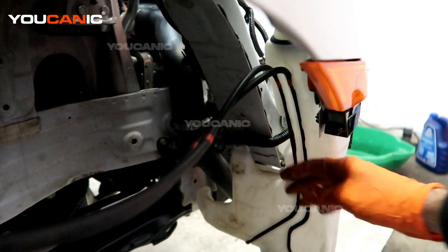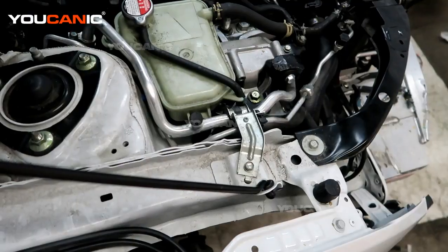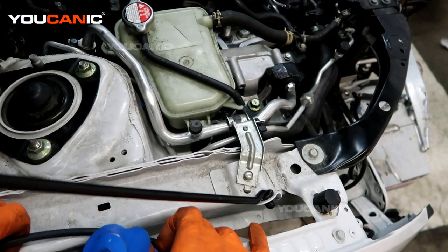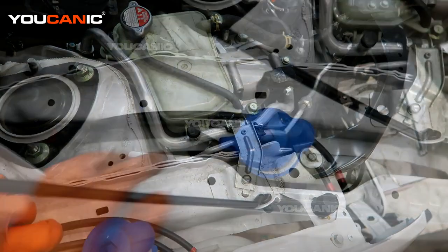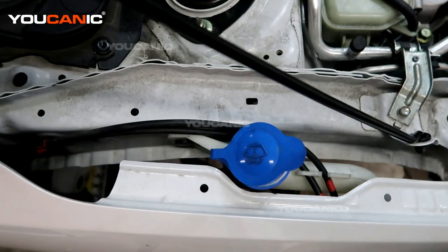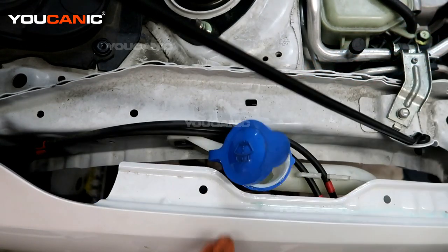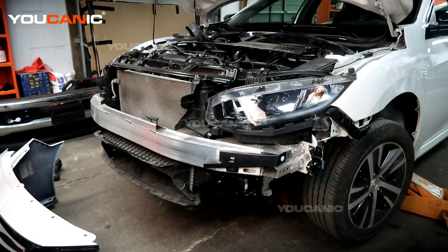Those lines are now up in the grooves, and there are just little clips up here where these lines sit in. The lines run along the front and back side and kind of wrap around. Put the clip back in — with that black clip installed, everything is now locked in place where it's supposed to go. We can now add our windshield washer fluid, then do a visual check to make sure it's not leaking from any of those connections, and you're good to go.